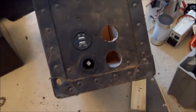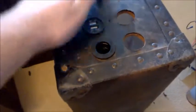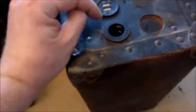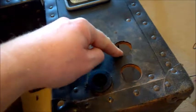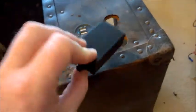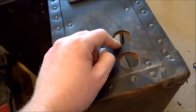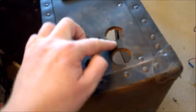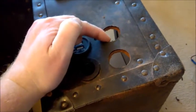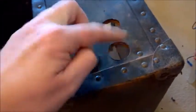So I've just drilled out three more holes. Put in a 12 volt socket there, USB there. It needs a good dusting — it's just from drilling all this stuff. I'm going to have a 12 volt USB socket here too. But behind here I've got a remote 12 volt relay switch, so I can use a key fob to turn these sockets on and off. Which will be great for lights, security, camping, and laziness. If you hear a noise at night, push the button and lights come on. When you go to bed, climb in, push the button, lights go out — or the fridge or whatever's plugged in there.